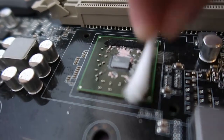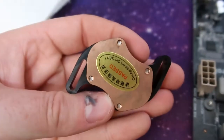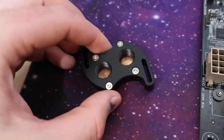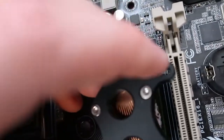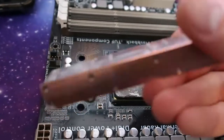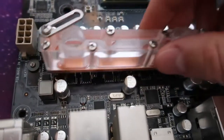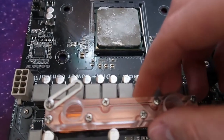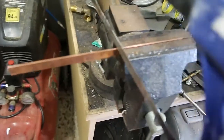If you do have tweezers, you probably don't want to use metal ones because they may scratch or damage something on the north bridge — just take your time and you'll get it all off. Now that the board's clean, I'm going to show you the water block I'm going to use. I got this off eBay; it was quite cheap, so I know it's probably not the correct size for my north bridge, but it's quite close. For the transistors, I've got a similar water block off eBay which is a longer one, but it's not long enough to cover all the transistors. So we're going to have to fabricate something so that copper will be able to transfer heat from the transistors up into that water block.